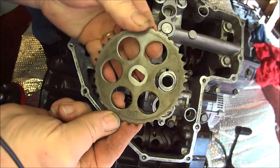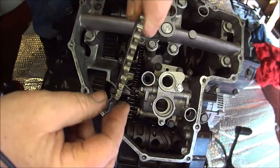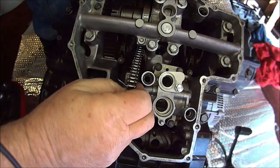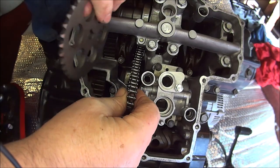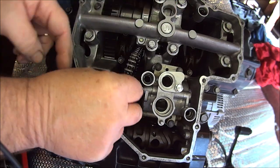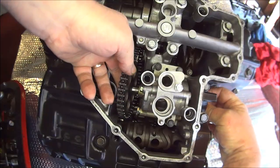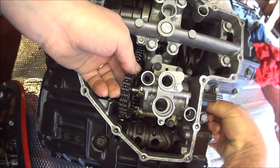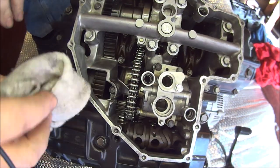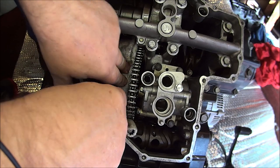Okay, then we have to insert our sprocket. Don't know if you can see that, but it says out. So that goes on the outside. So let's try and get our chain. Make sure it's on the crankshaft sprocket. And then try and get it onto this sprocket. Like so. And then try to line it up. Line the shaft up. There we are, like so. I would recommend putting a bit of rag down there, just in case,